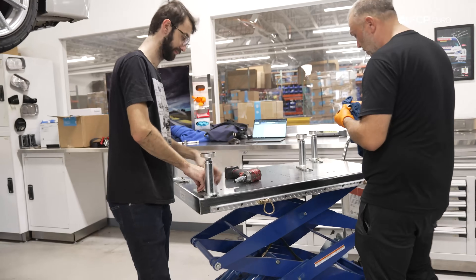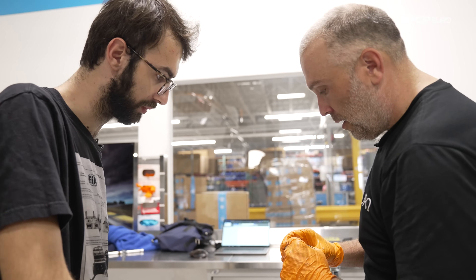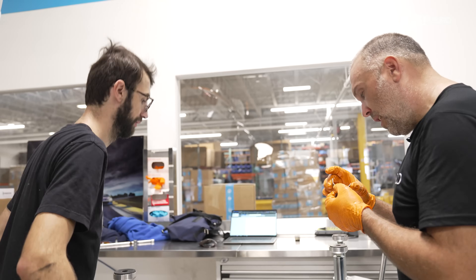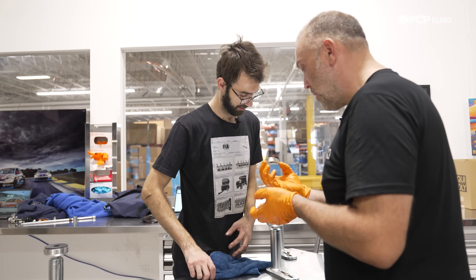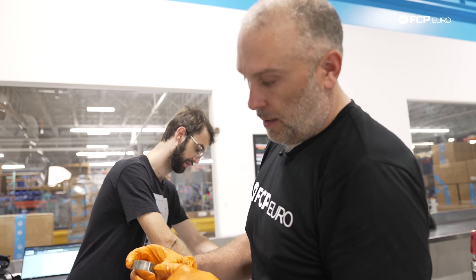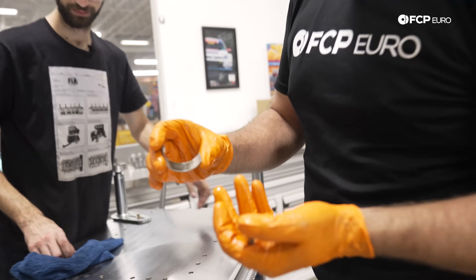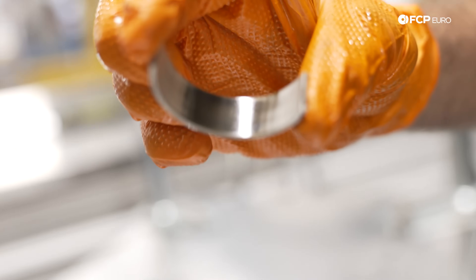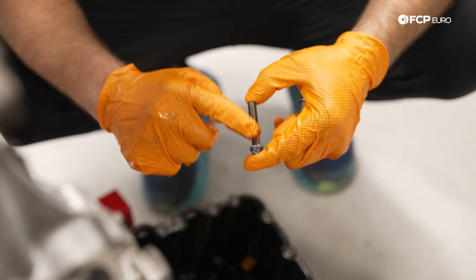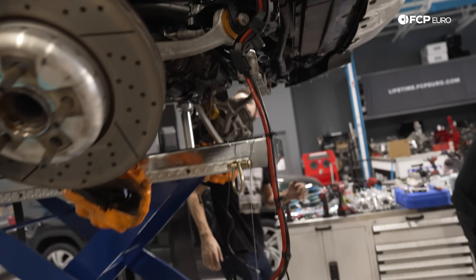This is interesting — look at the wear on the loaded side. Whoa, I've never seen that before. I think it may have been moving around — I think it was actually ovaled or something. The bearing may have been moving around in the block or in the lower carrier. It matches up with where the wear is, so the back side versus the bearing side — that's what we're seeing.